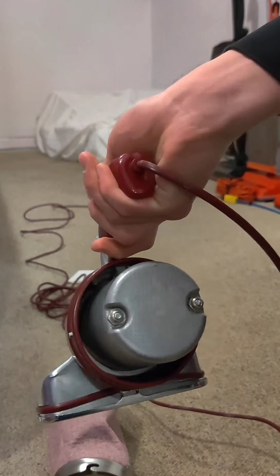But yeah, one thing I did notice with these, in toying around with it, the belt goes on the opposite direction than in a Dirt Devil. In the Dirt Devil, normally you want a, I guess, left-hand twist, I think. And with this one, you want a right-hand twist since the motor spins the opposite direction. So I had to have the belt pop off 2 times before I was like, let's try it the other way. It stays on this way, so apparently I got something right with that. But now it's working. Just listen, it's quiet. That's what I love about these vacuums, they're quiet.